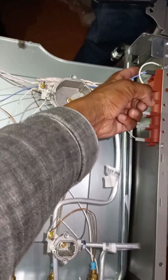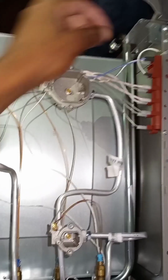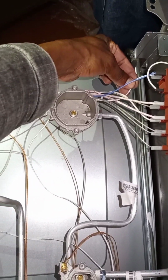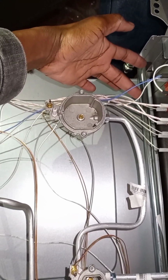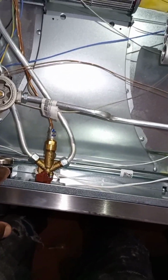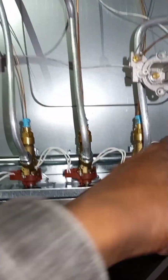This means that our spark module has 7 electrodes connected to it. So this is how a spark module works. It's powered with 230 there. That white wire is live. So this white wire is connected in series to every switch. This means that if one switch goes faulty, our supply is affected. This is where live gets electricity.